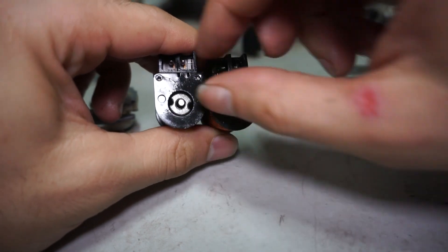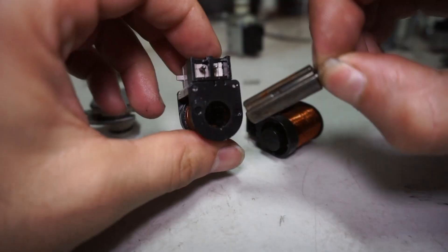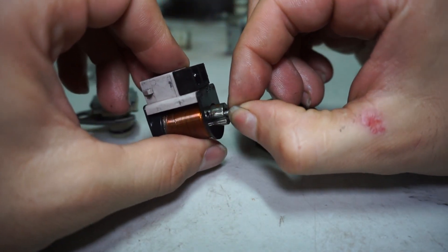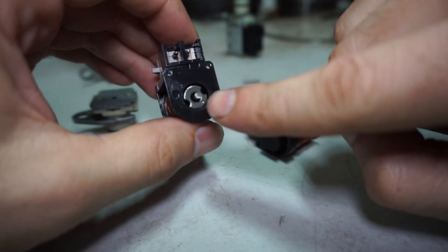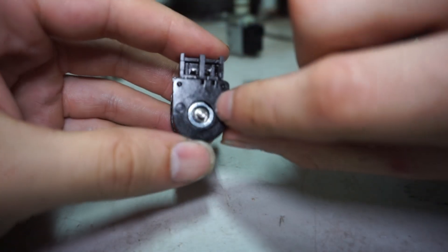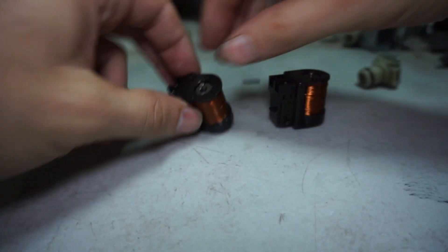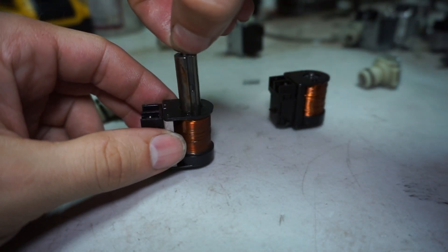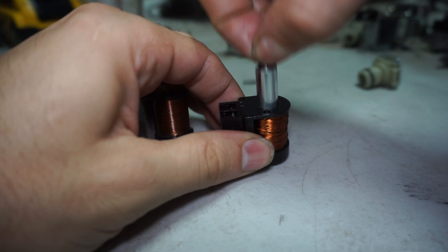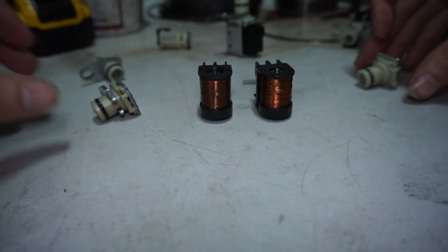These relief slots are pretty large and there are two of them. This passage inside the plunger is hollow and can fill up with fluid, so when it moves out that spring pressure has to push against the fluid to get the plunger back. The AC Delco has two larger relief holes; this Transtar one has a smaller one. I actually tested this in some water - I filled it and dropped them - and the AC Delco drops nice and quick straight down, while the Transtar drops at less than half the speed, kind of floating down. So the return speed is a lot slower.